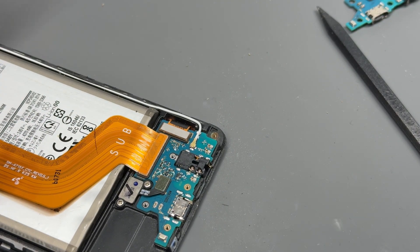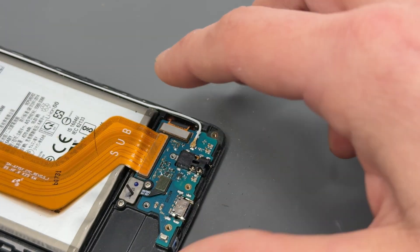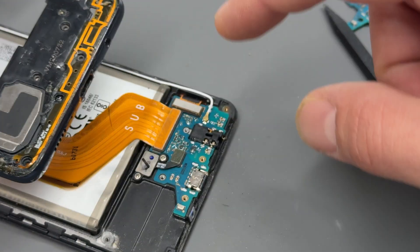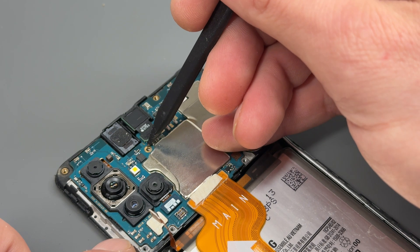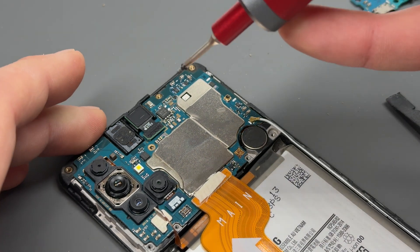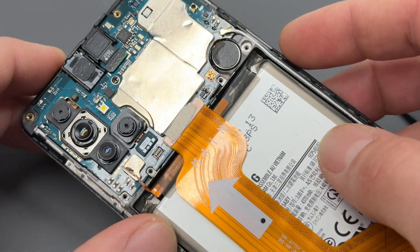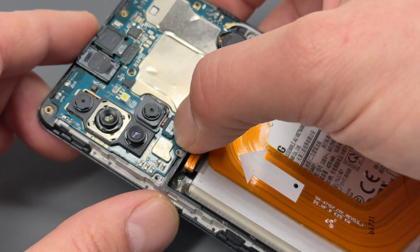Finally let's get the sub-to-main flex cable attached at the bottom. I'm going to have a quick look to make sure all these screw holes are going to be covered — those little black screws we took out often hold the board down. All the holes are going to be covered down the bottom. However, I know for a fact that this one here needs one of those little black screws, so whilst I'm inside the device we'll do some minor corrective work. I'm not going to interfere with that bit of tape because sometimes they are there for a reason — if I take it off and there are more charging problems, that's on me rather than the previous repairer.